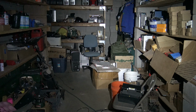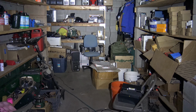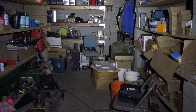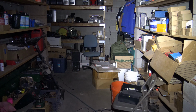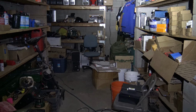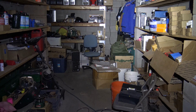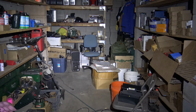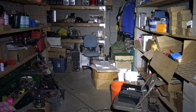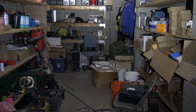Now if I double press, we're going to get to turbo, 1000 lumens for 4 minutes. This lights up the whole room. Then after 4 minutes, it steps down to high of 300 lumens for an additional 110 minutes. That's 1.83 hours. Now before step down, when the turbo is at 1000 lumens, you get 101 meters of throw and 2560 on the candela, so it's very impressive.